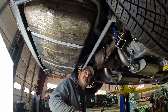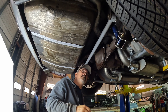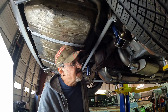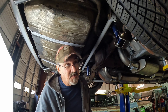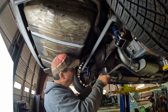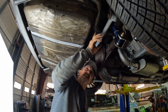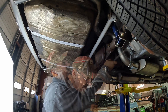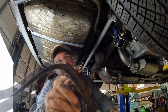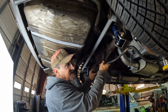All is not lost. My original plan was to build my own sway bar and mount it to the chassis up here. I've kind of had a change of heart on that for various reasons. Putting the bar here, it's questionable whether it's more or less effective as an anti-roll bar depending on where your end links are. However, I think I might be able to make this bar work with essentially the same modifications I was gonna have to do if I made my own bar completely from scratch. What I need to do initially is cut this bar right along here so I can get it mounted up, and once I do that I can show you what my thinking is.